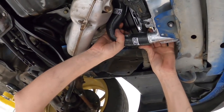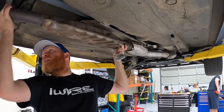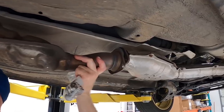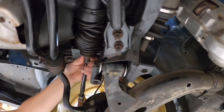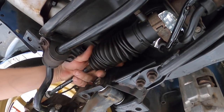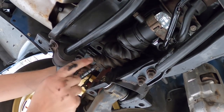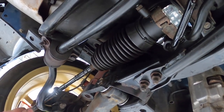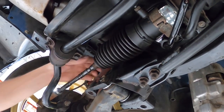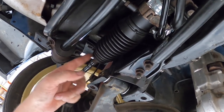Now just do the bracket - we're going to figure it out. So when you're adjusting these tie rod ends, you want to make sure not to twist the boot. That's what happens when you spin this rod and that boot sticks - it'll actually tear it. So what you want to do is back it off and then get some lube or grease and put it inside this clamp so that it moves freely. And now it's spinning freely.